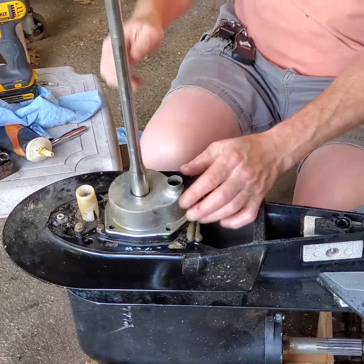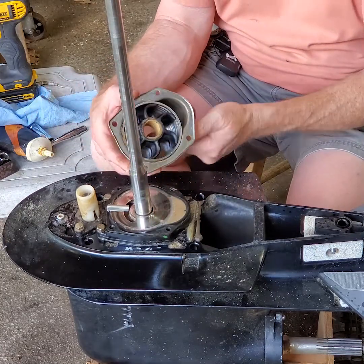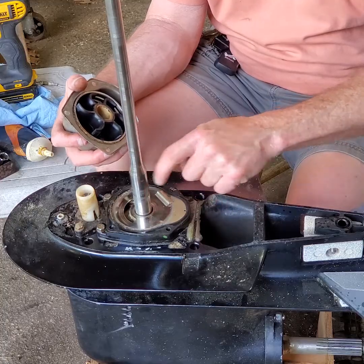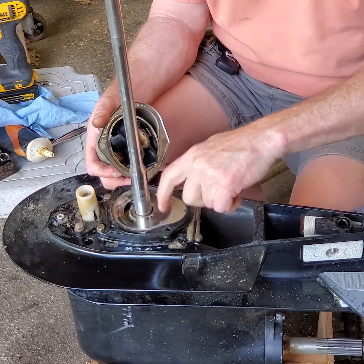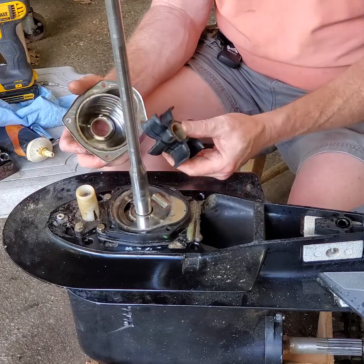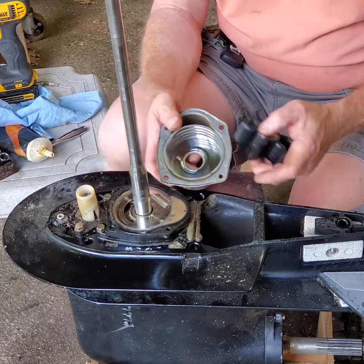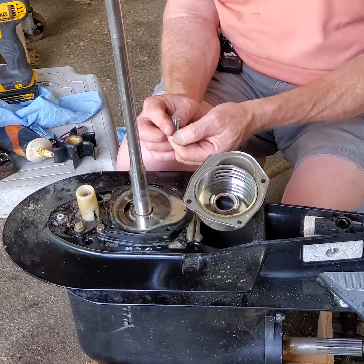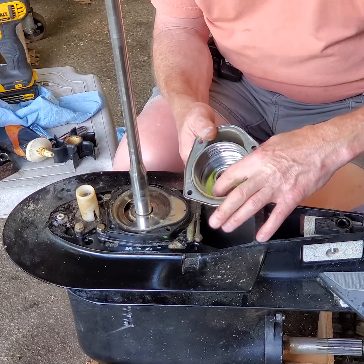Here's the key — you can see there's a tremendous amount of wear on this plate. This plate is devastated. There's a concave groove in here that will cause cavitation at high speed and can cause this pump to not pump water, causing you to overheat. The Mercury impeller is still in pretty good shape, but the housing is very scored. I would not put these back together again — the housing is scored to the point where I can feel the groove. That's definitely wiped out.